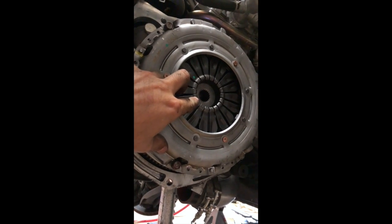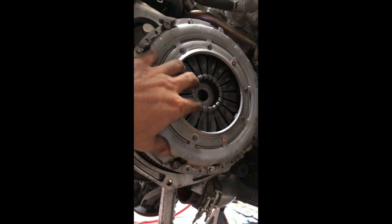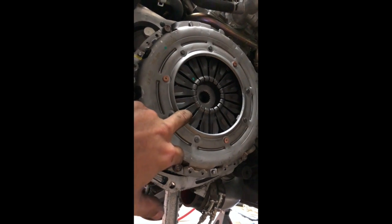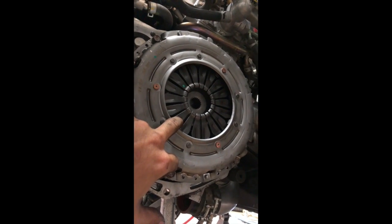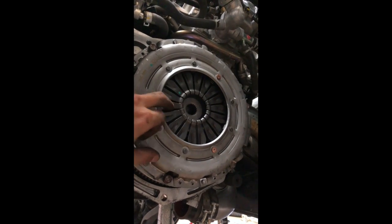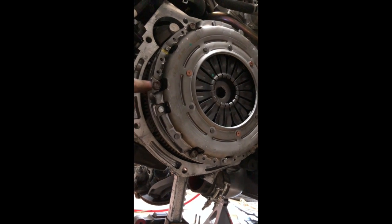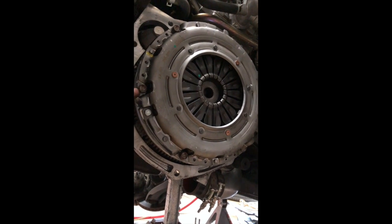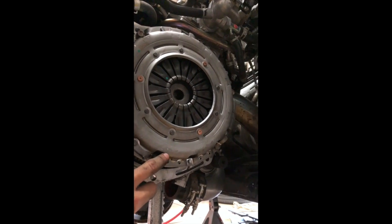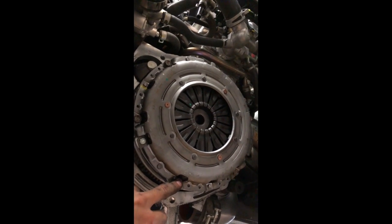As soon as you press that clutch and try to force it, you're gonna explode the slave or the bearing itself, and you'll have to take the transmission out and order that part, which is $120. So don't do that. Make sure that male piece is facing the motor. When we put the pressure plate bolts in, we use blue Loctite at 22 pounds. That's what I did on these. You can go 22 to 25 pounds, that's all you really need.